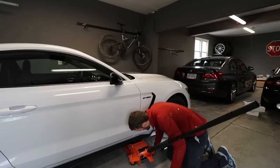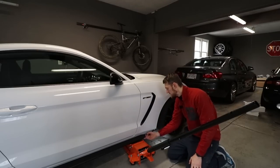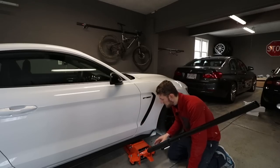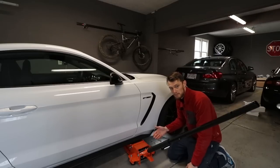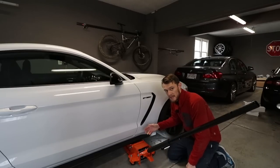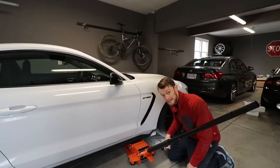Let's see it in action. I've put it under the car here, and as you can see it's right up to the limit of where it could be. I have about maybe a quarter to half an inch of clearance between the side skirt and the jack on my GT350. It's actually right under the frame rail, so if you want to jack off the frame rail, this is really nice to have this extra reach. That cheaper jack I thought about buying never would have been able to reach all the way in — this has that long reach, which is why the part number is LR. Otherwise I'd be stuck jacking off the pinch weld, but I prefer the frame rail because sometimes the pinch weld gets pinched or marred up.